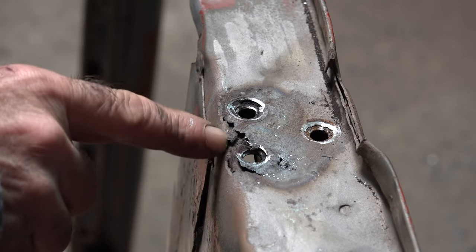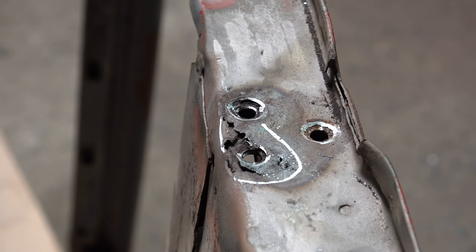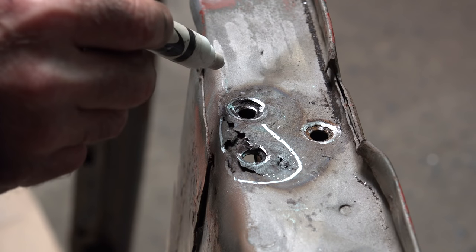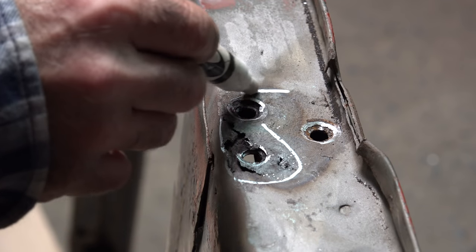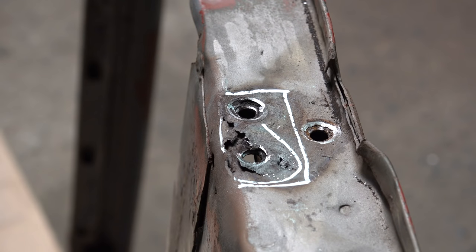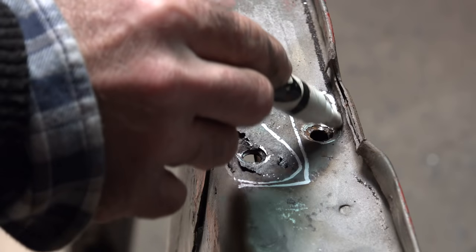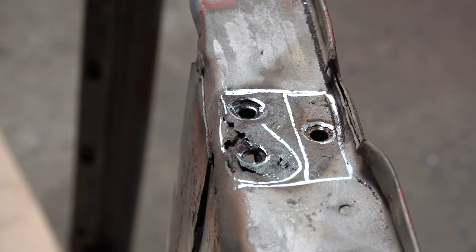The door is pretty much rusted over here - this is a real bad spot so we'll have to cut it out. I'll cut out a section like this; I don't think I need to take this piece with me, but actually let's do that too - let's put a patch in like this. That's the easiest way. So let me cut out the old metal and then we'll put a new patch in.